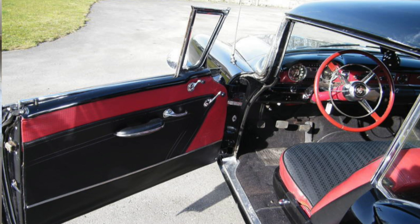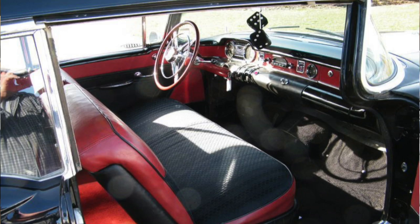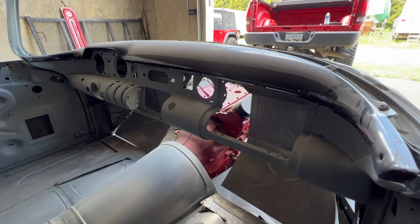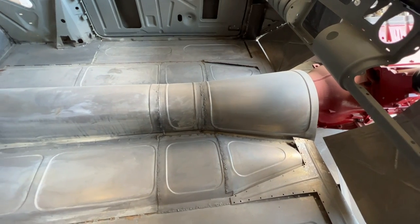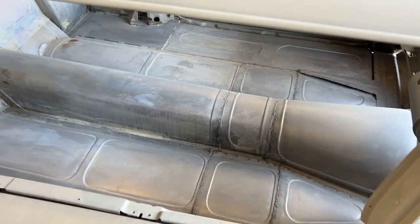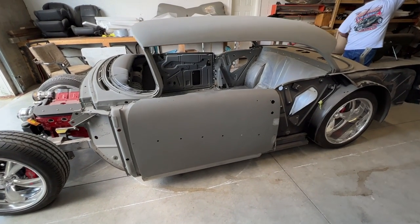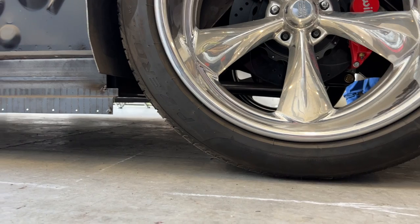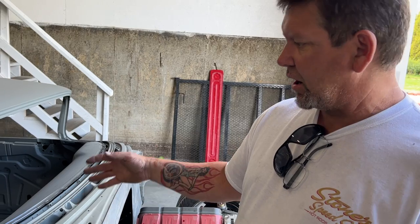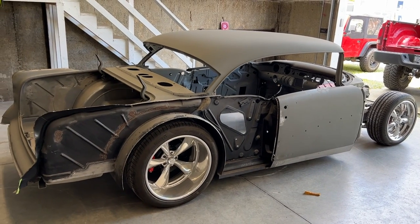I'm doing a mix of old and new — the interior will be modern but with classic materials. We're putting bucket seats in, but I still want classic designs on the door panels. Dakota Digital gauges, console shifter, floor shift. I've got a large tunnel in there and I've also Frenched the floors for the exhaust. I've dropped the body down over the frame and unibodied it, so the frame doesn't separate from the body anymore — the body is actually part of the frame. This lets me get the body down so low that it sits as low as a car on air ride, but because the frame is Frenched up into the car, I still have about six inches of ground clearance.